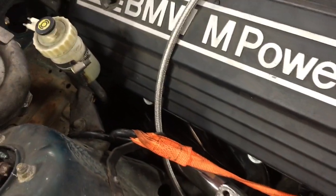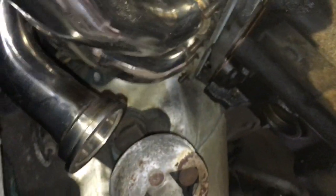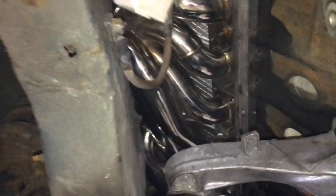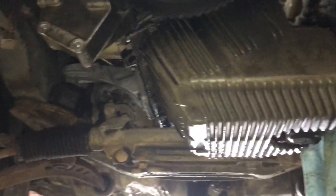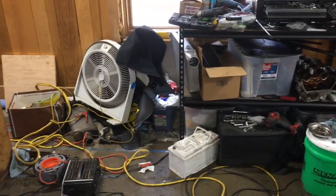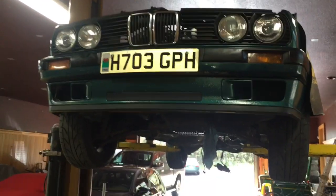The exhaust is going to be extremely tight. Underneath, the clearance between the external wastegate flange and the steering shaft is minimal. With a pair of E46 shafts you could probably squeeze it in there. All other clearances look fine — it's tight, but it's a turbo being shoved into a car that never had one. It's looking pretty good overall. That's about as much as I'm doing today; I just came out to get it sitting in the car. I'm bringing the charge pipe, MAF flange, and intercooler to a buddy to have some stuff welded on. That's a decent amount of progress for a weekend.